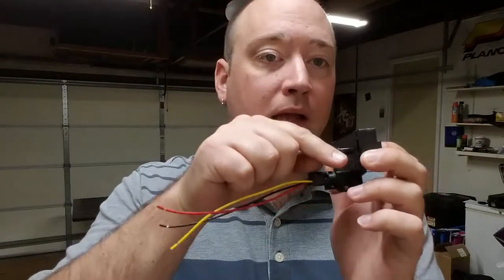The cool thing with the Micro Squirt setup is you can make adjustments pretty much on the fly. As long as you've got a laptop and some basic computer skills and you start understanding the programming, you can add a part or add boost and just make the appropriate adjustments. The car will not use mass air anymore — it will use a MAP sensor, which comes with the kit. All you do is take your factory MAP sensor out, cut the three wires on the factory harness, splice these three wires in, mount it on the firewall, plug in a vacuum line, and run it to the vacuum tree on the firewall. That's it.